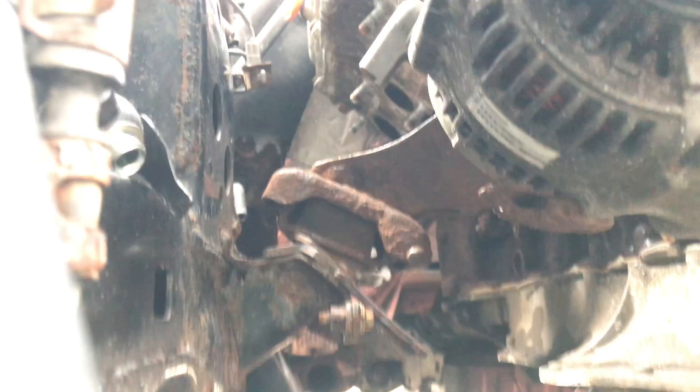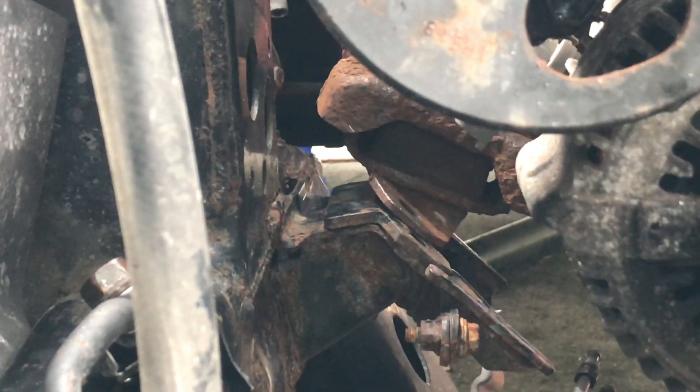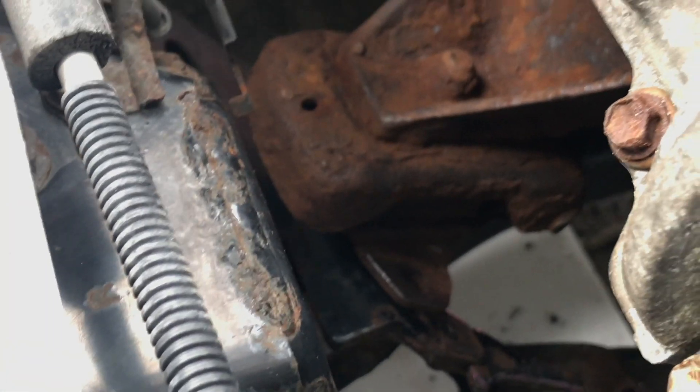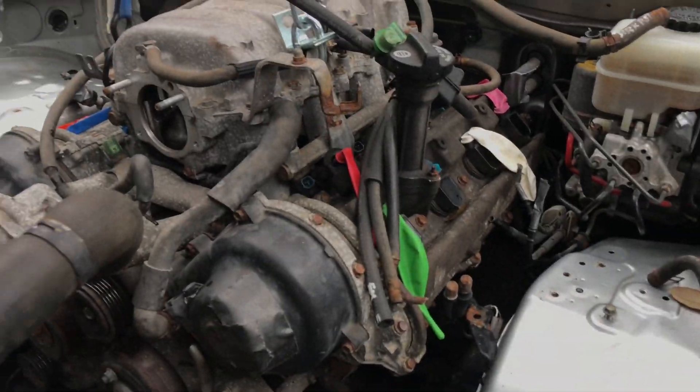I've put the engine back in without the pan — this is about as low as I can go. If I could get a modified pan made or make one myself, that's as low as I could go with this pickup, maybe not even that low. I can see the motor mount is just about touching on this side — the stock Tundra motor mounts are too wide essentially. I need to get the 4Runner V8 motor mounts and brackets as well. These old motor mounts are so rusted I couldn't even get the bolts off — I had to grind them off. It's pushing the engine sideways into the fuel lines, and the exhaust would push over into the steering.